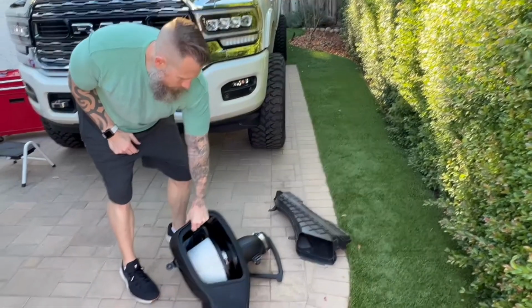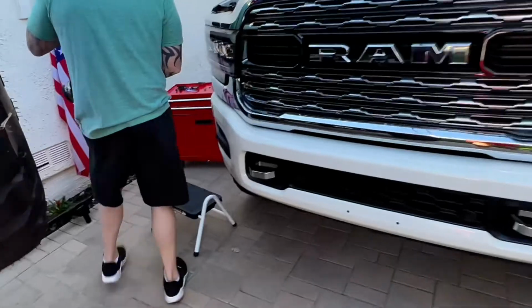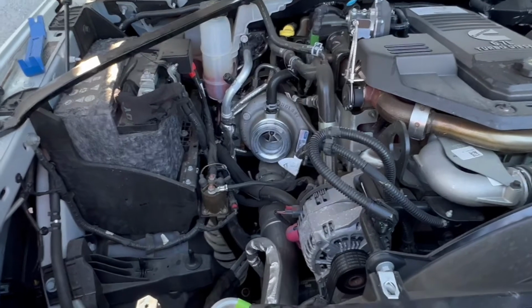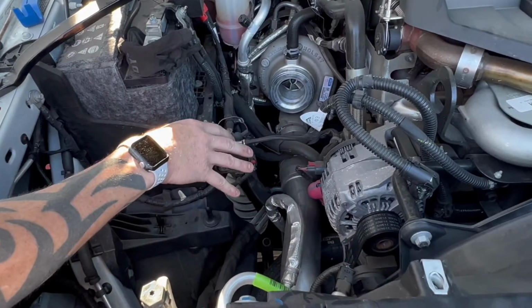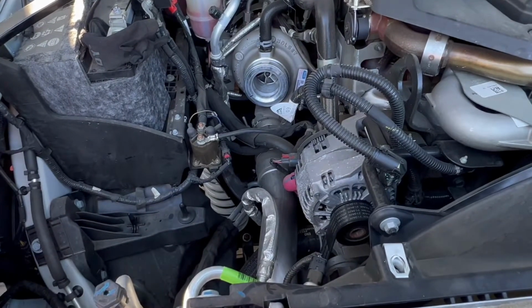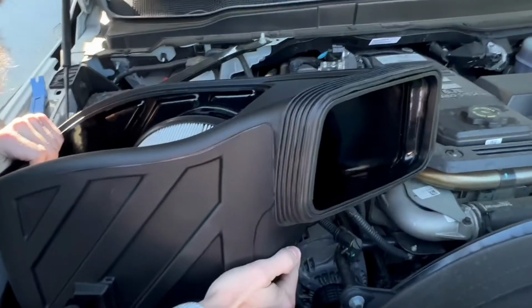All right, guys, so let's go ahead and pick up this box. We're going to install it now to the vehicle, so follow me over here. As you can tell, we have this big open spot where the stock one used to sit. What I recommend is when you're installing it, go ahead and do the tube to the turbo first, then push onto the grommets, because that way you have a little bit more wiggle room. If you do the grommet first, putting the tube on is going to be a little bit more difficult. So you kind of want to wedge this in. So you want to come off the back side. You want to make sure that the back coupler gets onto the turbo.